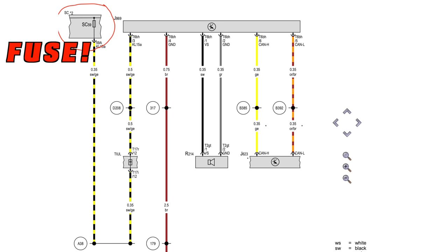There are two other ways we can do it on this car. The control module is directly fused, which means pop a fuse out and that should cure all of our sound actor problems — but just like unplugging it, we're probably going to end up with a fault. The other way is the same way we did it on the Mark 7, and that's just turn the volume all the way down to zero using the scan tool. Since this one is direct fused, there's no reason to even mess with unplugging it — we can just pop out the fuse.